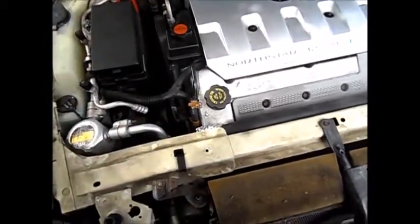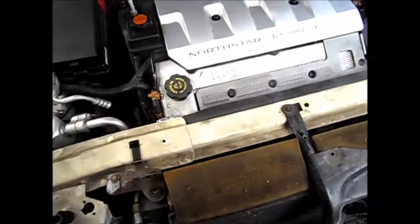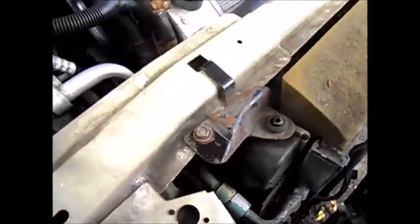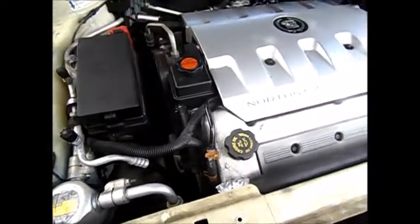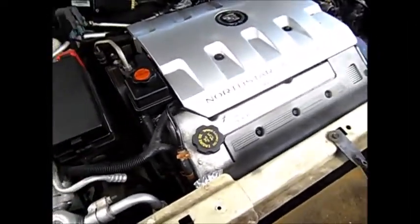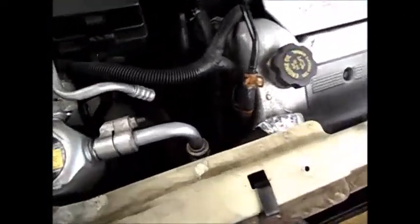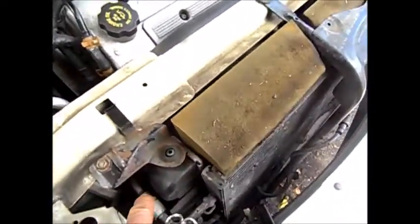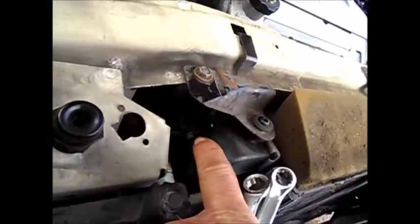Here's a dreaded North Star nightmare. What I did was let the car idle for half an hour to charge up the battery. Unfortunately, the cooling fans likely didn't come on or something, and it cracked the radiator. There's a crack in the radiator somewhere — I thought at first it was this hose connection here, so I put double clamps on it since it was a little loose, but that wasn't the problem.